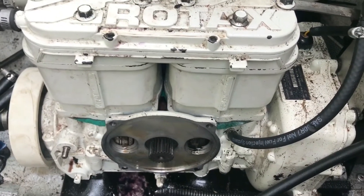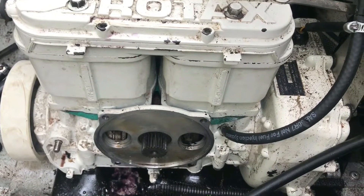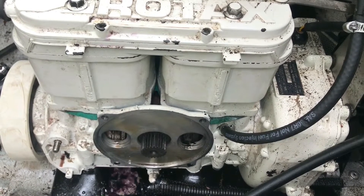Now that's back in there, we'll put everything back to top dead center, put the rotary valve in, and show you what that looks like — it's basically just a little metal half-moon plate. The shaft went in pretty quickly and smoothly. Greased it up, tapped it in slowly with the motor on top dead center. Now you have to put the snap ring back in there as a retaining clip — that's the hardest part of the whole job. Once you get the shaft in, we'll show you the rotary valve install, set the timing, and go over the degree wheel. The timing on these is actually really simple to set.